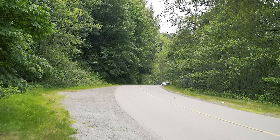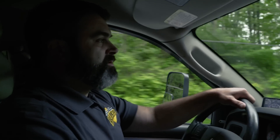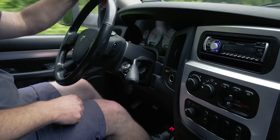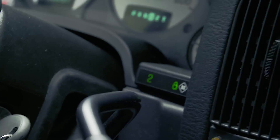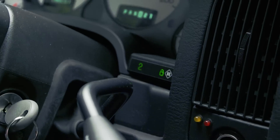And now we're back to the stock factory shift schedule. We're starting to descend down the hill. We're gonna lock up the converter, so to engage the torque converter with torque lock, we use the tow haul button — press it once. That locks up the converter. Now it'll stay locked up until we select that button again to shut it off. Torque converter lock up is indicated by this little padlock that illuminates on the display screen.